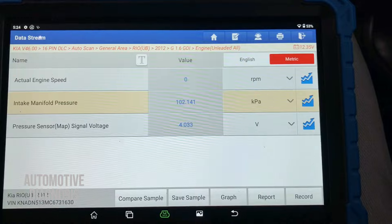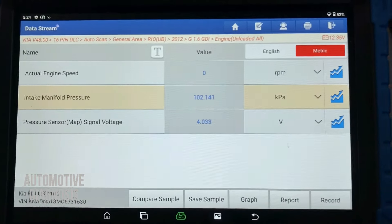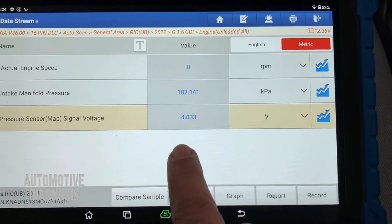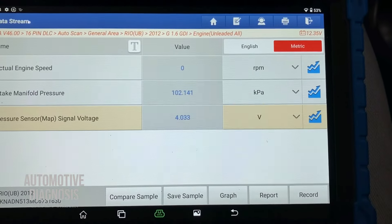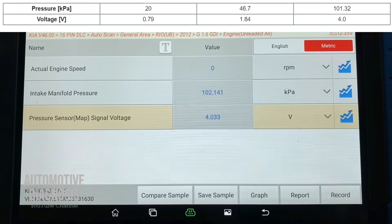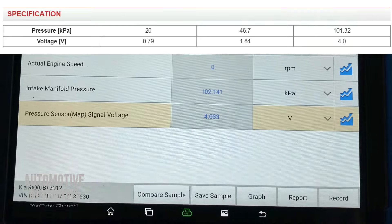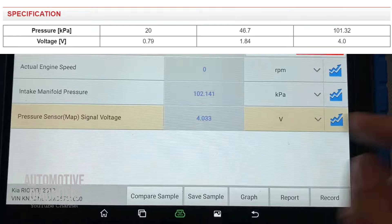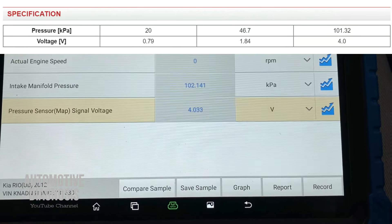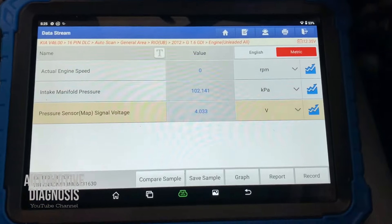Select those three items. With the engine not running, there's no negative pressure being generated, so we're just reading normal ambient pressure — the MAP sensor is outputting 4 volts right now. Our reference is the workshop manual specification table for this car. At ambient pressure the voltage should be about 4 volts, which matches exactly. When the engine starts, pressure drops and the output voltage should drop as well.